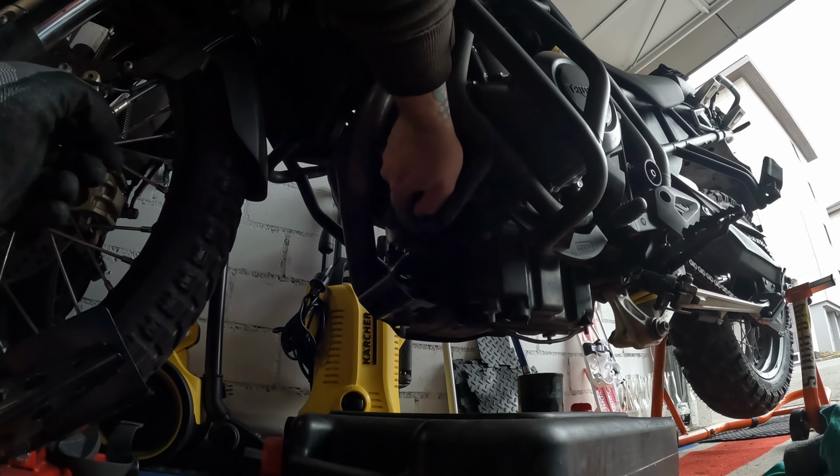So that's done now. Filter is changed, bolt is back in. Always think about the little plastic foil, think about the little rubber O-ring, and don't forget to put oil back in it. That's gonna be my next step, but before I do that, I'm gonna clean it up a bit